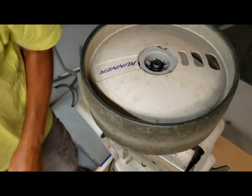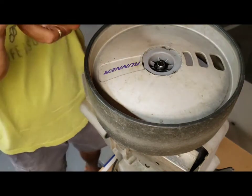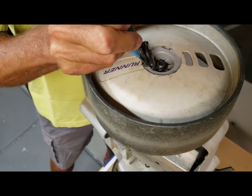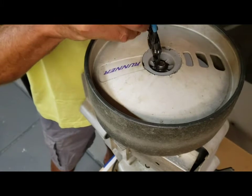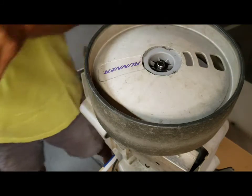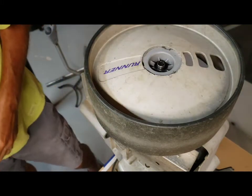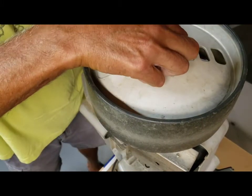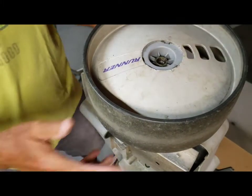There's a retaining ring that's got to come off. It's a split ring, so you'll need the tool to insert into the split ring, spread it apart, and lift it off. Get a good handle on it — make sure it's in there good or it'll go flying across the room. Remember to put everything aside in the order that you took it apart because I'm not going to show you how to put it back together. After the split ring there's a washer, and then the wheel will just lift right off.